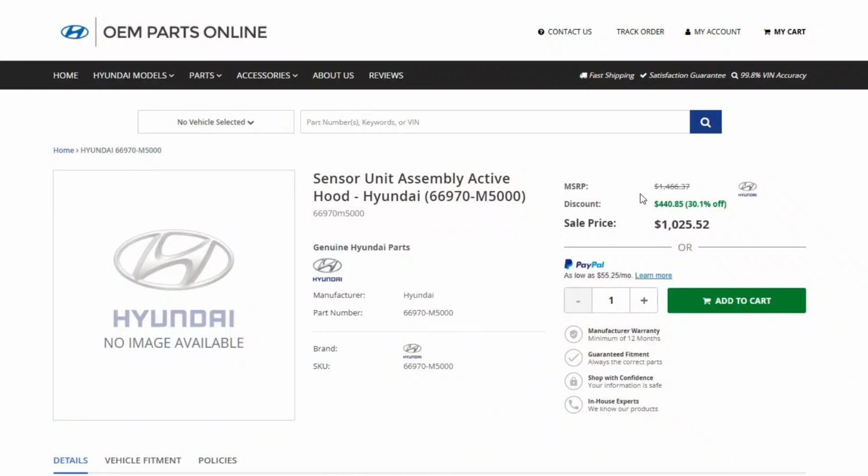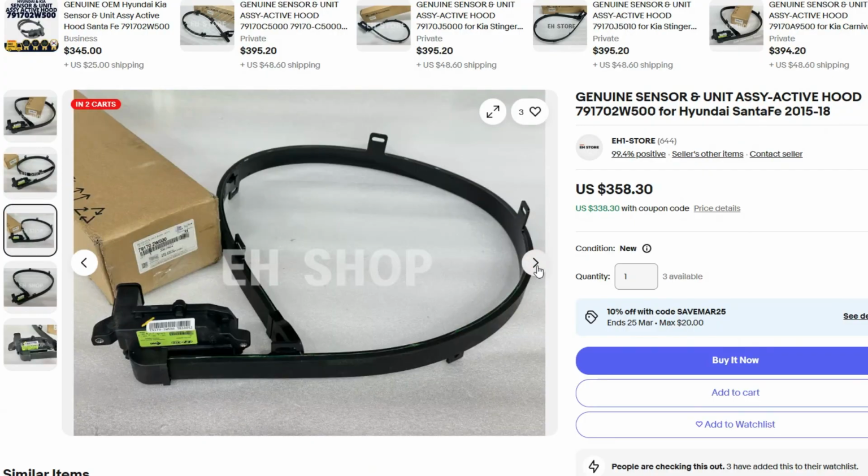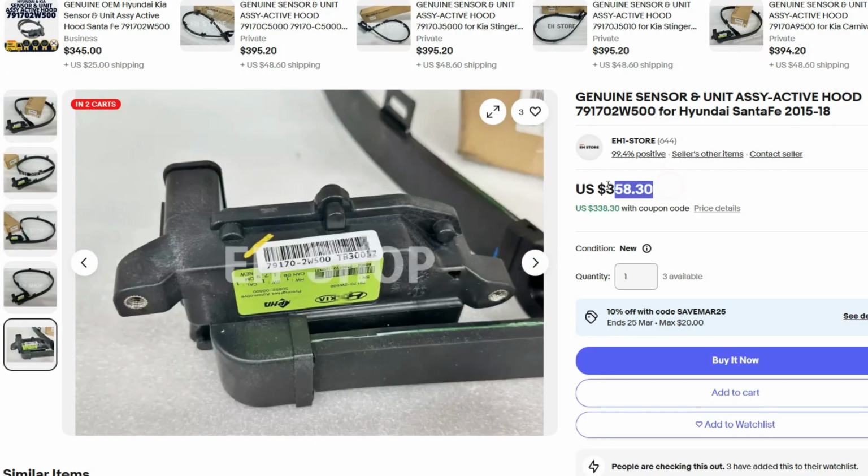Unfortunately, the new sensor is extremely expensive, and depending on the model, it may cost over 1,000 euros, but fortunately there are a lot of Hyundai Tucson cars in scrapyards all around Europe, and you can buy the used sensor for something like 200-300 euros. Just pay attention that the sensor is not from a car damaged in a front-end accident. You can replace the sensor on your own, and it may not even require any programming. It should work well after you start the car and the system gets proper readings.